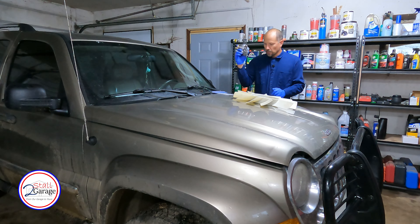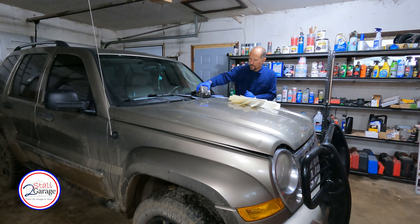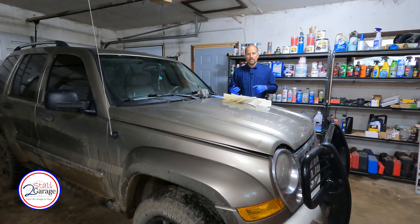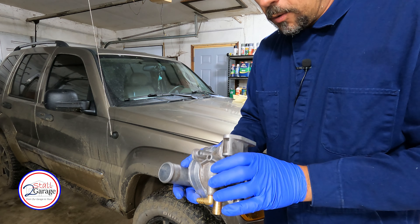In this video, we're going to go ahead and install this upgraded thermostat assembly with the 203 degree Dodge Hemi thermostat in it — I think it's for the 5.7, could be multiple models. We're going to see if we can fix the not getting up to engine temp when it's 60 or below, and we're going to try to fix the overheating or running warm while towing. I hope this video provides you guys and gals with a little bit of hope for your Jeep CRD.